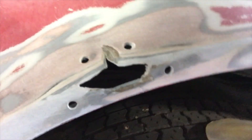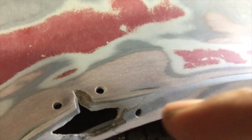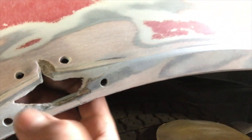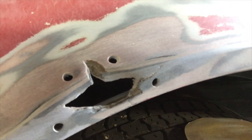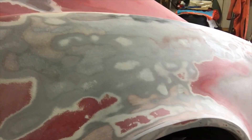Okay guys, I'm back. I went and got some spatulas and some sandpaper for the DA. Anyway, I came back — I told you guys about that hole. Here it is, you can see right there. What I did was drill these holes so when I put the fiberglass, it seeps through and grips all these holes, making it stronger. I put fiberglass over the front and back. While that's drying I'm gonna start glazing.